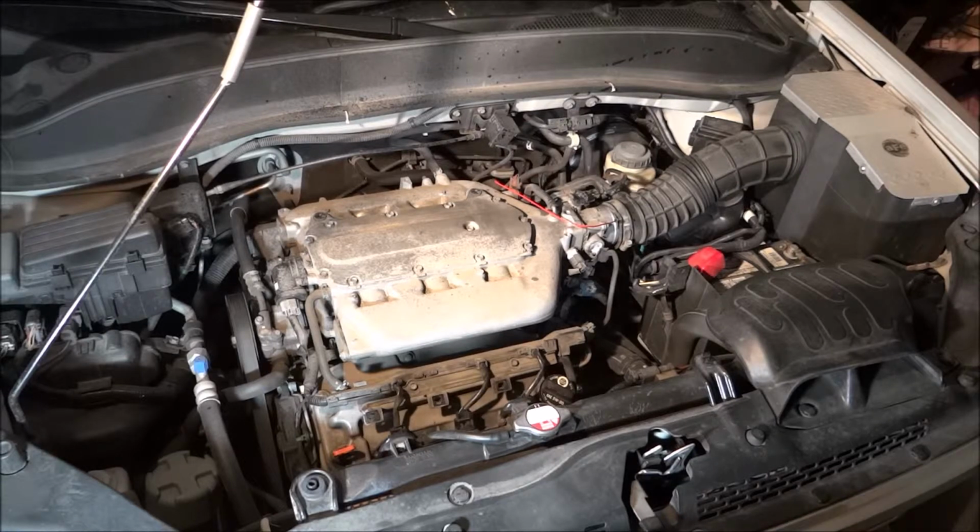All right, so now it says to let it hot soak for 5 to 15 minutes. I'll give it 15 minutes to give it the best chance. And then it says take it for a drive and drive aggressively. So I'll do that. I'll come back and we'll take a look inside the combustion chamber and see if it made a difference. I also took some pictures of the spark plug itself to see if this will help remove some of the deposits on the spark plugs. They're pretty old, so we'll be able to tell if it actually made a difference.